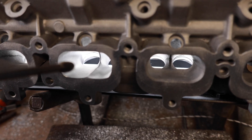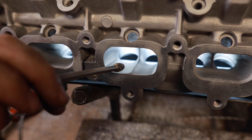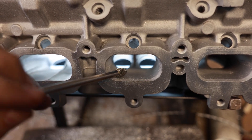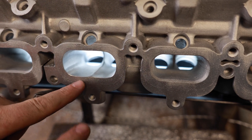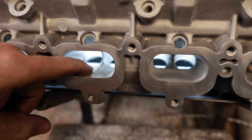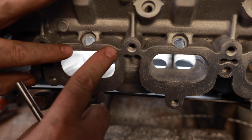Here you can see a dramatic difference in the Head Games port. You can see the divider — I brought the divider all the way back into the intake port and it's all sanded. I actually sanded everything to 60 grit because we need the definition so that when we go to digitize it, the information will come out cleaner. If you look at the factory one, it's pretty much boring. Now if you look closely, you'll see that I actually did not change the port line — the line is the same. I didn't lower the port; I just reshaped inside the line. Everything inside is now reshaped with a fin, the walls are reshaped, the port is widened and deepened on both sides, widened around the short turn, but I did not make the actual port opening any bigger.